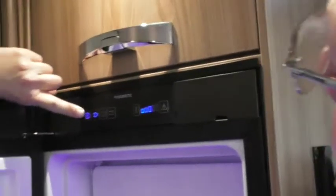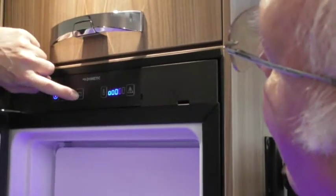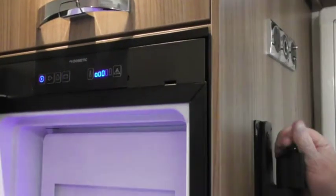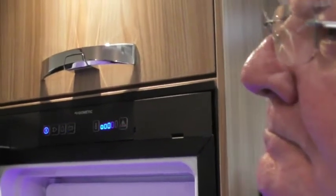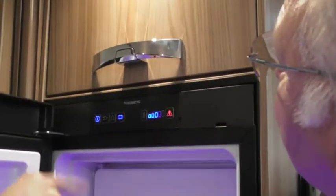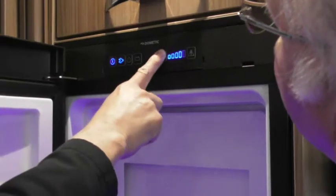Right, fridge. Nothing too complicated — on/off button there. Not like the new ones; you can operate those off the app, but not this particular year. On/off button is that one there. You can switch electric on, switch gas on, or 12 volts — that's 12 volts from the car. If you're operating on gas and it shows an error, if the gas light is on it means either you haven't switched it on, you haven't got any gas, or maybe there's a bit of air in your system. Check those things, press that button and it will retry lighting it.